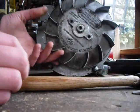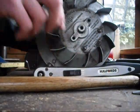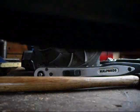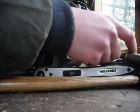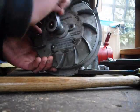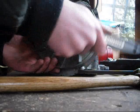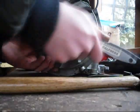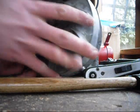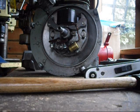There we go - that's the flywheel loose. We'll just take the nut off. The flywheel is keyed on the shaft so you can brace something in there, and that should allow us to get it free. There you have it - there is the magneto. I hope that helps some people; it shows it shouldn't be difficult to remove the flywheel.